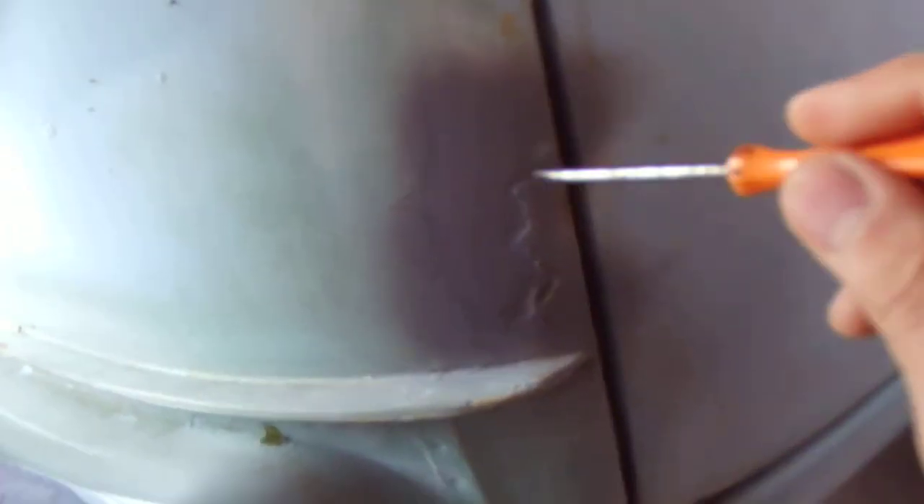Going down the side here, always rust here. There's a little bit of rust on this one that I bought about a year ago — a few little pinholes. Someone has put filler there in the past. Going inside, I'll show you the filler there. Always look along this seam. See this filler here, because it's smooth and it goes all the way up, so there's going to be a little bit of rust hidden under there. This one was originally green — someone's painted it flipper blue, so I will restore it back to its green and white.